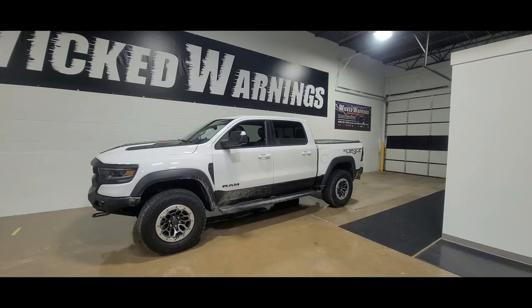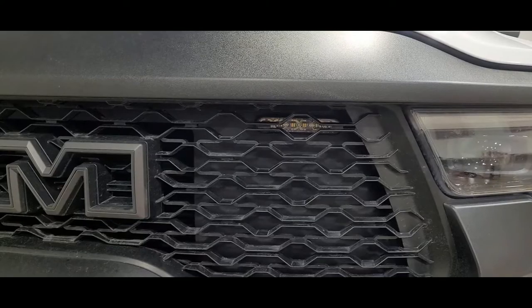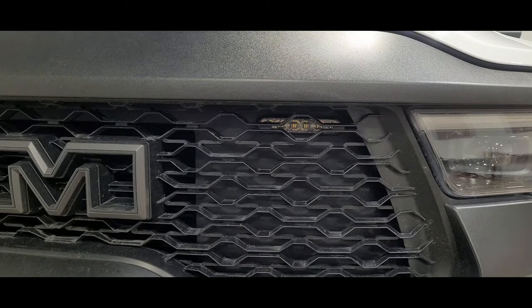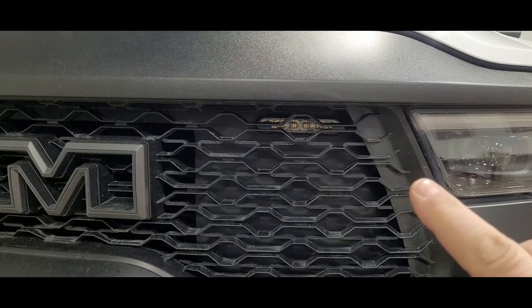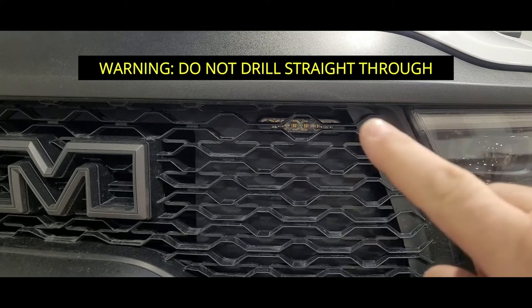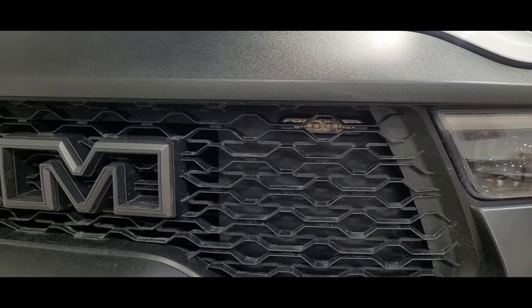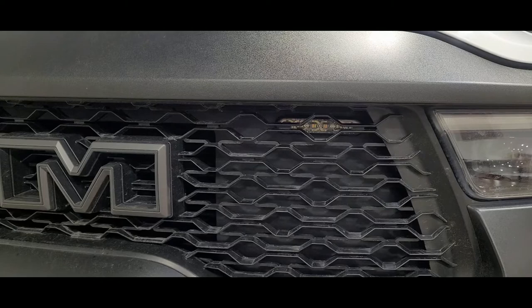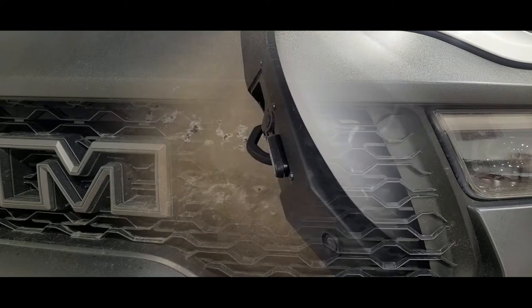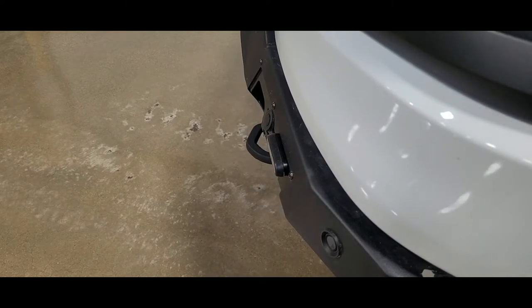As far as the surface mount lights that are on this truck and the WAF kit, that's pretty much all it is. Not too many TRX owners out there, but if you like this package, you have a TRX with the same kind of bumpers, you can do the same thing. That's how we mounted the light in the grille — it was actually tucked between the grille and the back surround and a hole was drilled. Be very careful on this one because there's a washer reservoir behind that hole, so you cannot just drill straight through. The other side is very easy to get to, but that's how we tuck those lights right behind the grille — they mount with self-adhesive 3M VHB tape. Use some primer promoter, mount them up in there and it's very easy. One last note: you can see on the bumper lights we added the 15-degree wedge to bring the angle down because the bumper was quite leaned back, pointing the light up at the ceiling. We added the 15-degree wedge behind that SoundOff 3-inch light and that tipped it back down level, making the light much more effective.